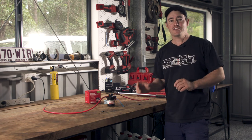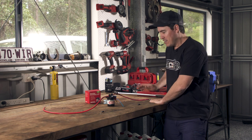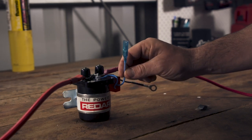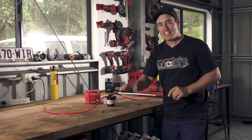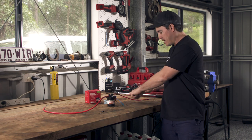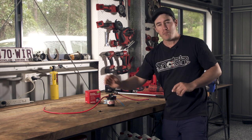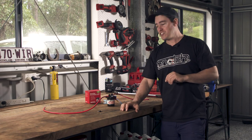Here is a basic dual-battery system, or an isolator. Look how simply it works. You have your start battery here, you connect that to your isolator, and then you have your second battery over there. You've got a ground wire, and an override wire, which is really neat. An override wire means you can complete the circuit back to the isolator with a switch inside your cab. So if for some reason you flatten your start battery, you can actually start your vehicle off your secondary battery — it overwrites the isolator. You also want to fuse the wire from your start battery — I suggest a midi fuse — likewise a fuse between the isolator and your second battery. You pretty much should fuse every single positive wire on your vehicle. That is a basic isolator. They work really well in older vehicles with a fixed-voltage alternator — super simple to install, yet super effective.